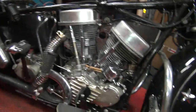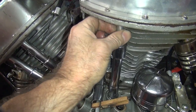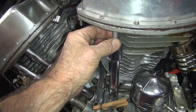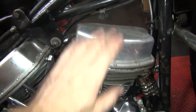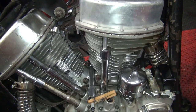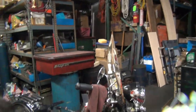Of course, now I've got to recheck the intake because now I'm in the right spot. The valve's tight — it's a little snug. So it's too tight now. I've got to readjust the intake because when I want the valve to be firing, I adjust the valves so when the motor is actually running, the valve is closed all the way. Right now the valve's tight — that's not a good thing. I adjust it right here.